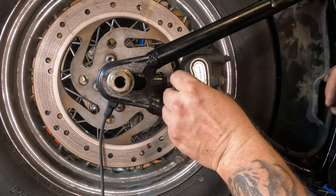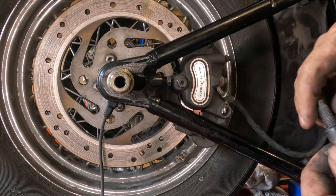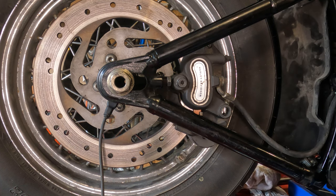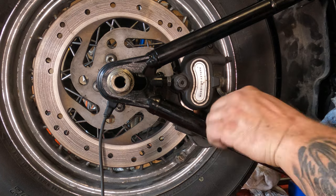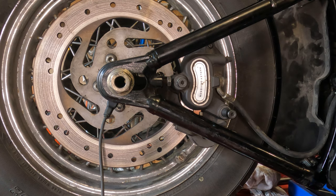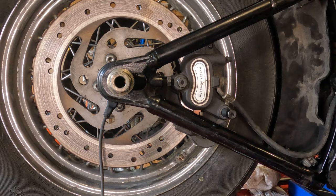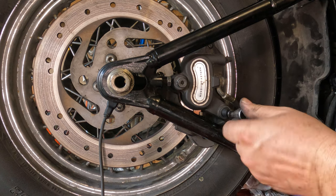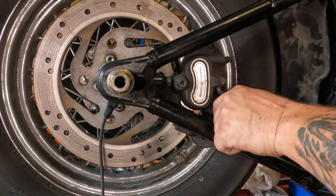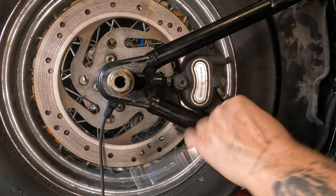Now, you can take this bolt that goes in the back there, and thread it in, get it to start in there. Don't thread it in all the way yet. Now, take your front bolt, wipe the threads clean, and thread that one down in there. Locate the Torx bit socket that you had for this that you now can't find because you're disorganized. There we are. Take your T40 Torx bit, and that thing should thread in there relatively easily, till it stops.